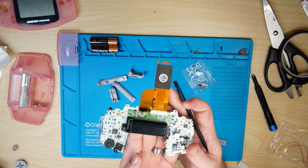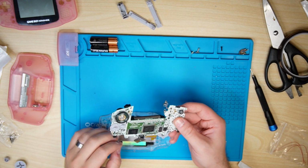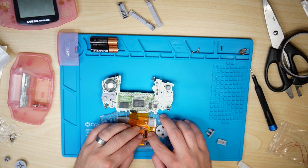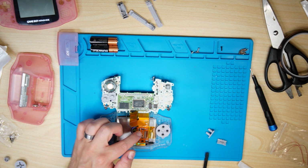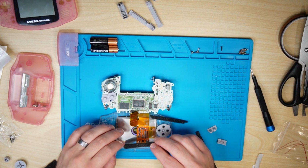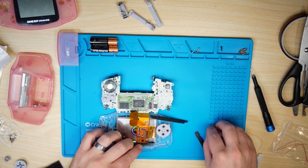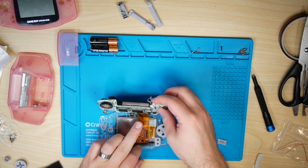It's kind of hard to see because it's clear. Of course, everything here is clear. Put in your flex connector from the LCD into the flex connector. Now, the next part is you have to take a foam piece that they provide for you and put it on top of a touch capacitive button that is at the bottom of the flex. This allows you to use touch controls to change the brightness of the screen without having to do any soldering, which is a true drop-in solder-free thing.